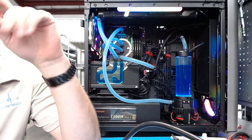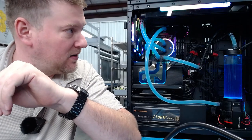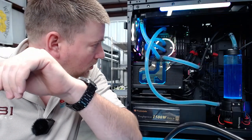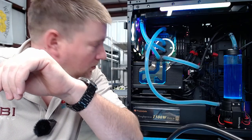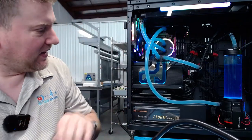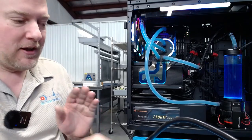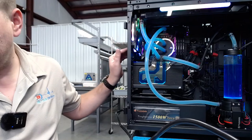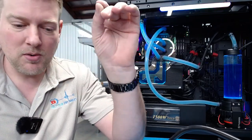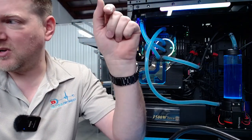Well, guys, it didn't beep. That's a good thing. That means that it is posting, but I don't have a monitor connected, so we won't know. I guess I'll save that surprise for when I get home, whether or not it's really posting. Normally, if you have a memory problem, if you didn't plug something back in, even if there's a problem with the CPU, it'll give you a beep code during post. And the beep code is going to be like beep, beep, beep, beep. And it'll tell you like your memory's bad or your CPU's not plugged in or whatever. But it looks like it's posting just fine.